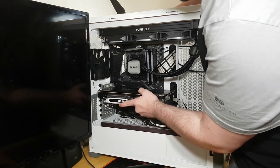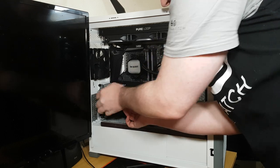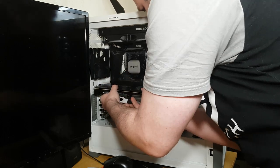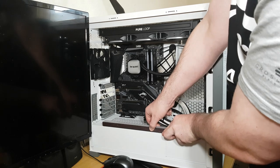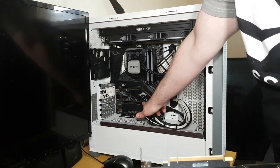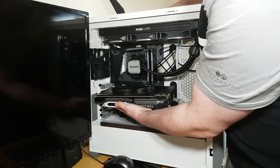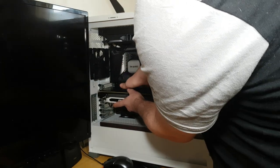For the installation, hold the graphics card by its cooler and press it into the slot like that. There's a clip on each PCIe slot — once clipped in, the card doesn't move because of the little edge on the PCB which clips on. To remove it, press the clip like that and pull the card out like that. It's simple — that's all there is to it.